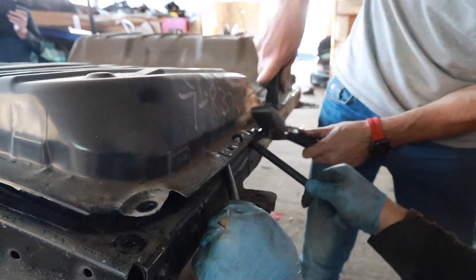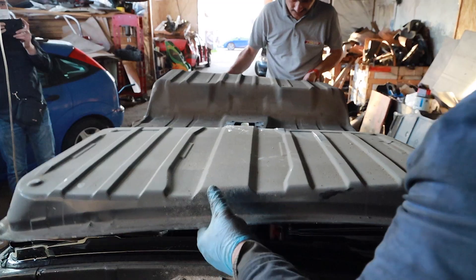When you purchase a used Nissan Leaf battery you must remove the top case. The top case is hard steel and is very well fixed on the bottom one. You must use a knife to cut all the adhesive on the sides, and be careful when doing this because the Nissan Leaf battery is a high voltage battery — it's a 400 volt battery. After you remove the battery from the car, remove the case and you will reveal the modules.